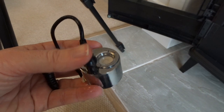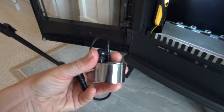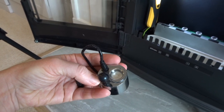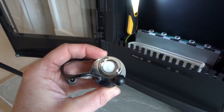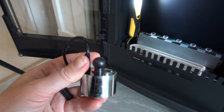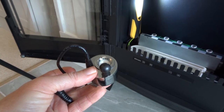If your fire has stopped working and the mist is not coming up, one of the first things you need to do after you've cleaned it is actually replace the transducer. When I contacted Dimplex and explained I had no mist coming from my Optimist, it was under warranty and Dimplex sent me a new transducer to try. If you don't have a warranty, you can easily get these from Amazon, eBay, or spare parts companies, very cheaply. So if your fire isn't working and you've given it a really good clean, change the transducer first and see whether that's the reason.